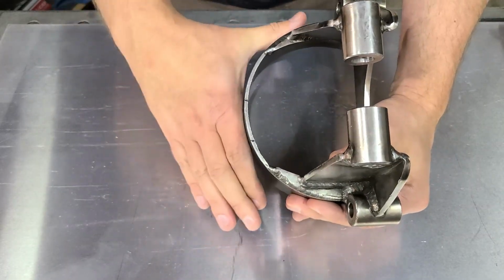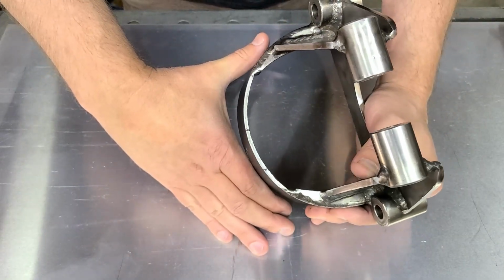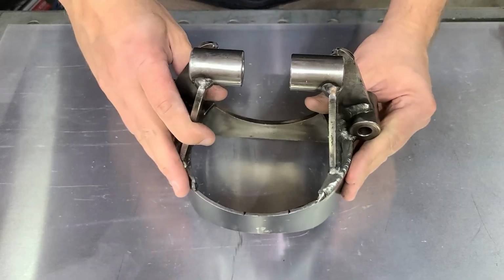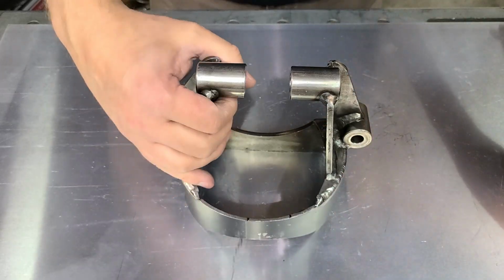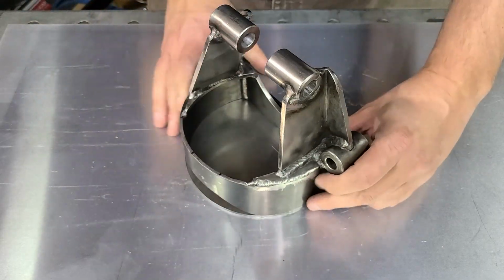Also, when you tilt the hole in your frame forward, that's going to open up that gap just a little bit. And if you already have big gaps, that's going to make it worse. And you could get big gaps because this template is too big.